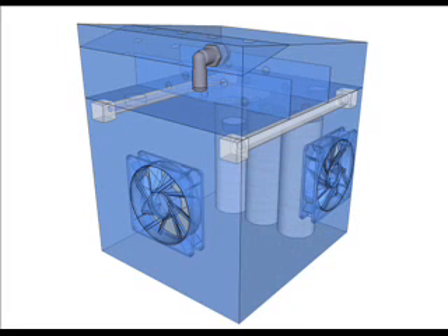This is the CAD drawing I did of the permanent housing for the hydrogen cells, electrolyzer cells, and the water tank. It's got all its cooling in there - fans blowing directly onto the cells and blowing out. This will be stored in the boot pretty much where the trial unit is at the moment, all measured up to fit. All the connections are in-house with little plugs for the wiring on the back, all disconnectable so you can just remove it if you need to. The water tank at the top has baffles to stop the flow of water when driving from splashing up into the gas outlet nozzle. There's a baffle at the top as well, and it's slightly angled forward so the gas has to go to that top point - the only place it can get out.